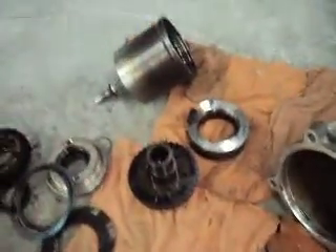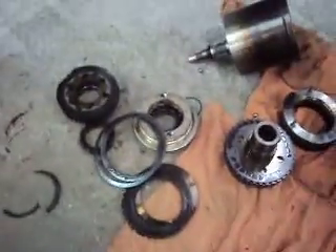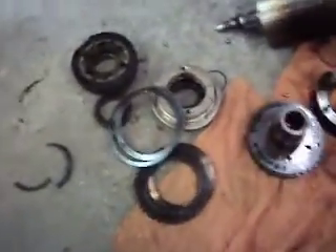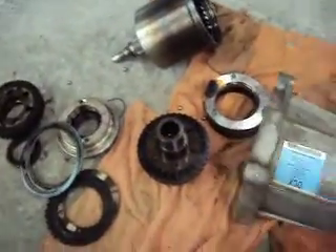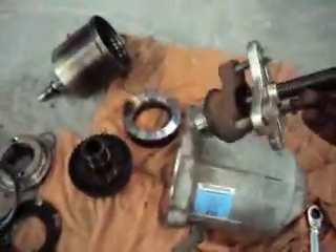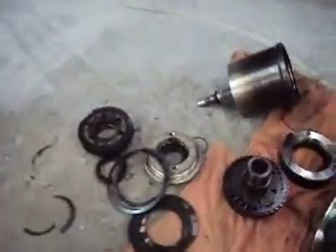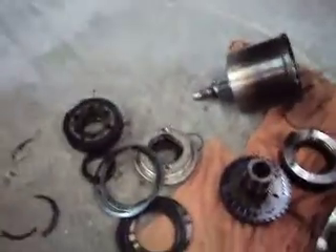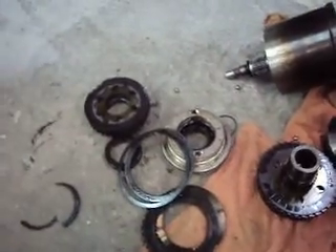It's not the greatest setup in the world. The vehicle only had about 60,000 to 80,000 miles on it, and it was an 07 Pacifica. Replacing this whole assembly — it comes complete, just four bolts to hold it in, and bolt your drive shaft back up to your yoke, and away you go. I did change the gear lube in the rear end — it's just 75-90 synthetic. But again, the gear lube in the rear differential does not lubricate the clutch assembly here.